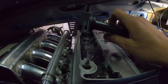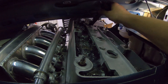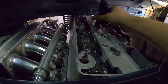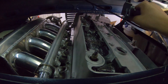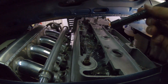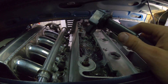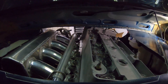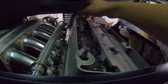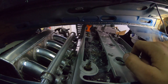Back in the car - first thing is to see if I can get a stock coil into that number one cylinder, which I don't believe I can. Nope - so two, three, and four fit, but that first one is a problem. For all you guys running stock coils you're not going to be able to get that front one in and out. Let's also see if our dipstick fits - yeah, the dipstick fits. Let's see if it fits with the cover on.